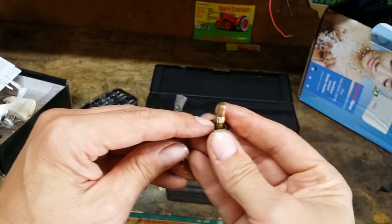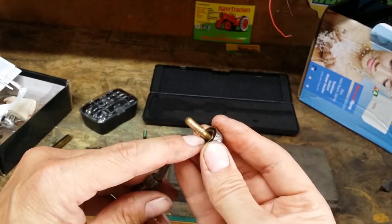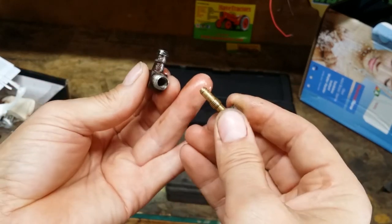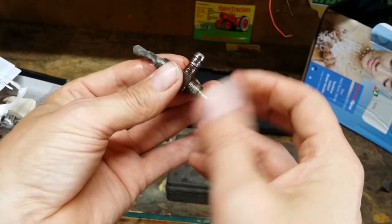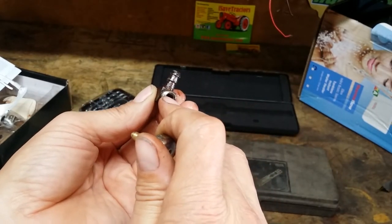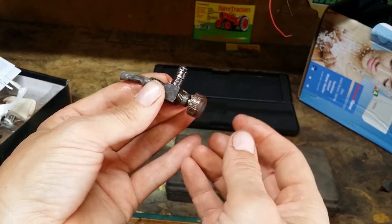There's supposed to be an o-ring that goes on here. I removed that o-ring thinking that could have been part of my problem, and removing the o-ring was not fun, but I have to put a new one on there yet. You can see there's the threads and the little tapered section — that is the actual stopper valve. It looks like a pretty straightforward thing. What was happening is gunk — dried-up deposits of fuel — had built up on the inside of these threads.